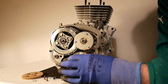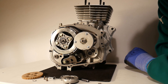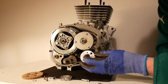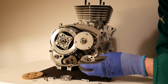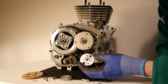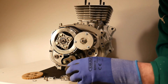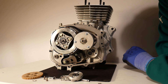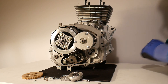So that's the oil pump on a motorcycle engine — it's just that simple. There are only those few little components, and that's what most motorcycles rely on. Again, it's called the trochoid oil pump because of the shape of the little gear on the inner rotor and the outer rotor. If you open up the oil pump on probably most motorcycle engines, you will recognize those two gears — the inner gear and the outer gear. Hopefully you got something from that and now have a good understanding of how the oil pump on your motorcycle engine works. If you like this video, hit like and subscribe and I'm going to keep the content coming. See you later everyone, bye!